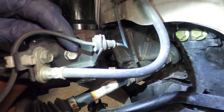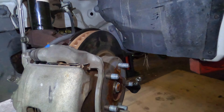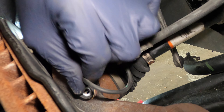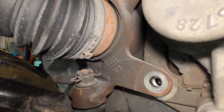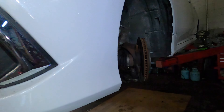We need to take off the ABS sensor, which is right here, and remove the brake caliper. We also need to remove this bolt right here. So far: this piece is 12 millimeter, this is 10 millimeter for the ABS sensor — just pull that out. These over here are 17 millimeter — one right there, one right there. Now we need to hang up the caliper.